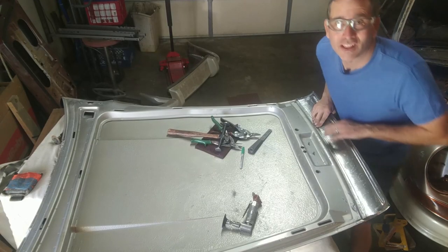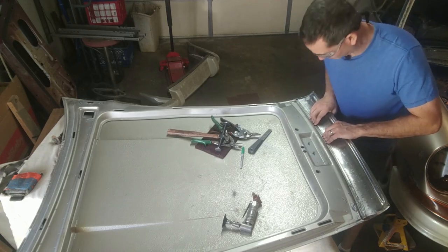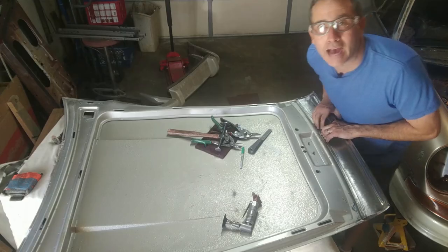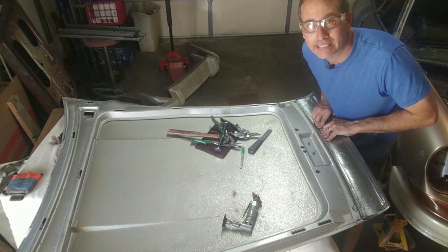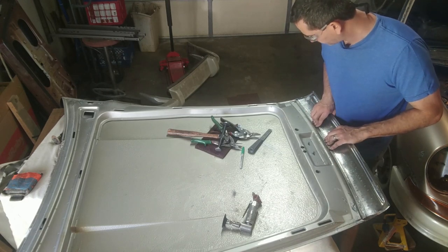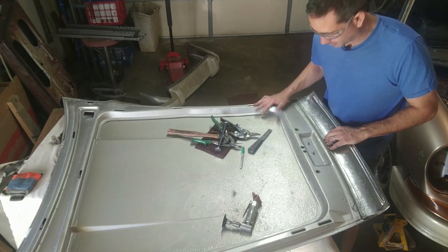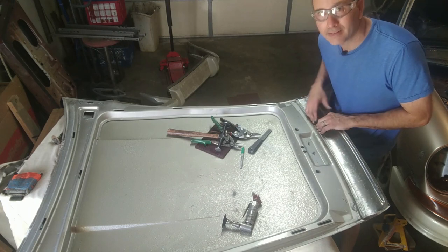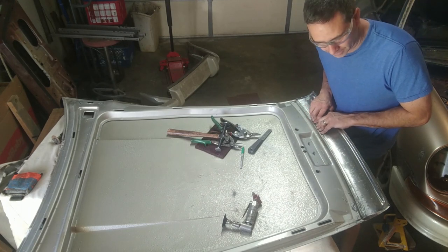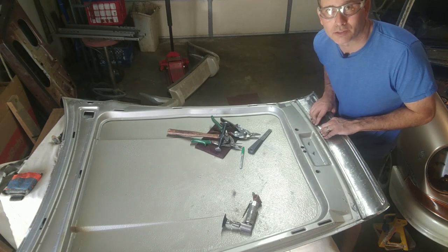Holy moly, that was a lot of work. It was about 10 times. I mean, is that a thing? 10 times a charm? I needed to get this gap in pretty tight so that the TIG welding was as easy as possible. Maybe I could have done a little better with a cardboard template, but when it's a blind edge like that and you don't have a whole lot to mark with, it's just time consuming.